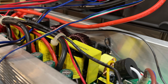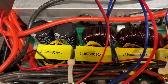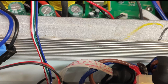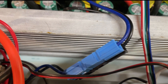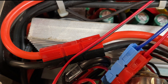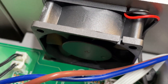I'm imagining the charge controller is either here or in a level below. I did not take this apart because it's a rat's nest. It's worth noting that this area is very dangerous — anywhere you see a lot of capacitors and AC power, you do not want to touch that unless you know what you're doing. There are very large heat sinks on the inverter, which is a good sign — two really long aluminum heat sinks. Cooling is provided by a pair of fans at the top that push and pull air through, so there's really good airflow.